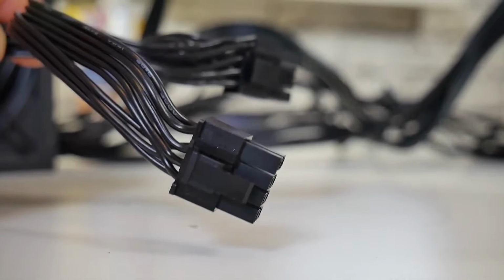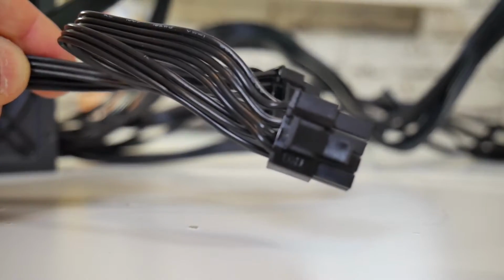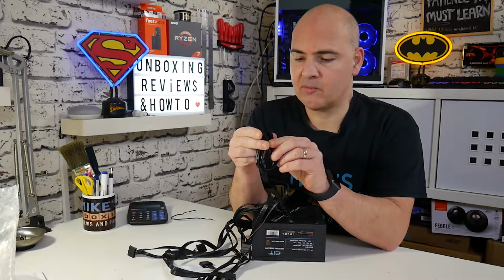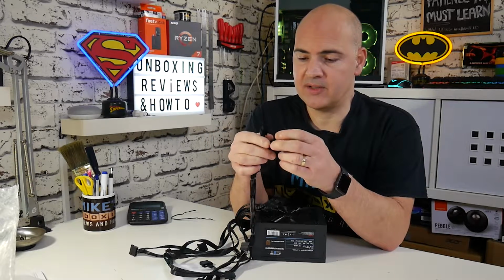A lot of power supplies these days just have ones where you kind of push it together, whereas that actually slides on and will hold in place. And if you've got a graphics card which requires 2 of these, then you've got them 2 daisy chained. So again, less cables to manage, so you can just fold that around, cable tie it out of the way, and it should look pretty neat.